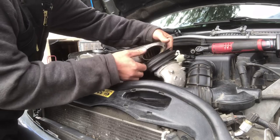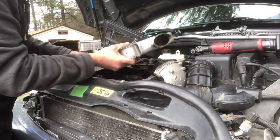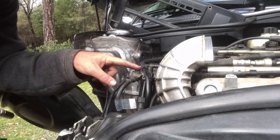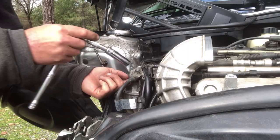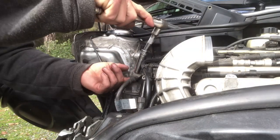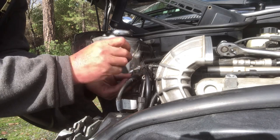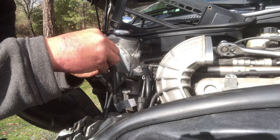Once you have those brackets removed, go ahead and pull your intercooler off. My intercooler boots have seen better days, but luckily I have another set. Next, move on to the motor mount — remove the ground strap. There's a bolt that could fall out, so hold onto it from the bottom as you break it loose. It's a 13 millimeter. Keep the bolt and nut attached to the ground strap so you don't lose them.